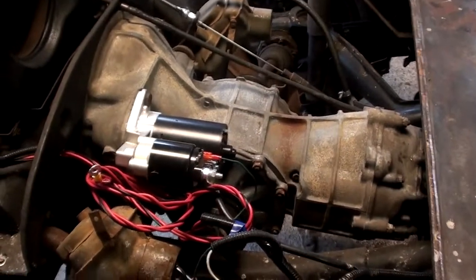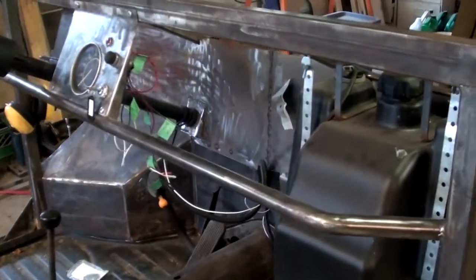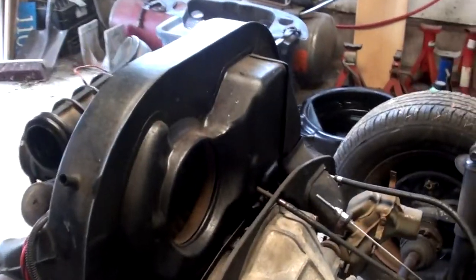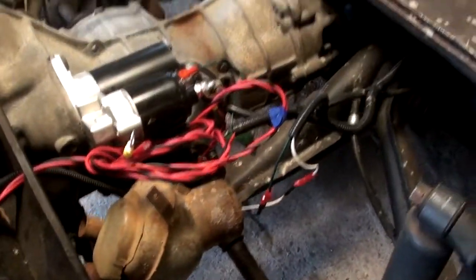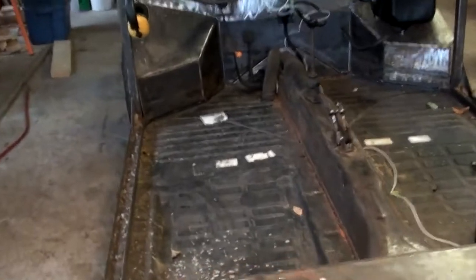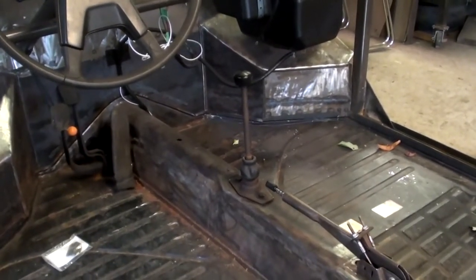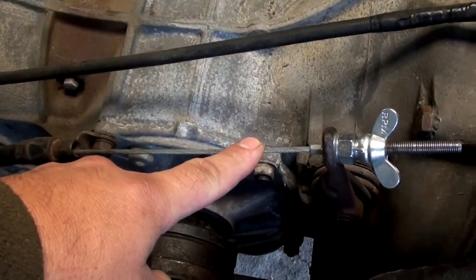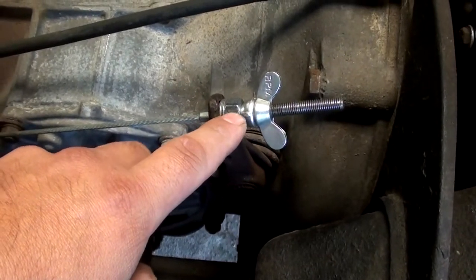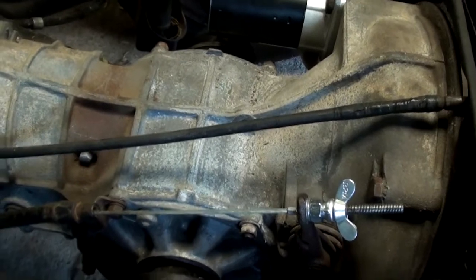I did tinker on it a little bit over the summer - played around with the electrical and did some wiring. It's got a new starter and new battery. The big news is a couple weeks ago I decided to throw on the axles, and because the engine's running I thought maybe I'd be able to get it to drive under its own power. I was able to start it in reverse, back it out of the garage, then start it in first gear and drive it around - pretty cool. The clutch wasn't working but I did some research and it turns out these aftermarket clutch cables are too long, so I just needed to shim it with some washers and a nut. The throwout bearing is now able to contact the pressure plate and disengage, and I'm able to shift while the engine's running.